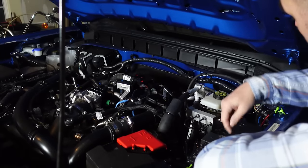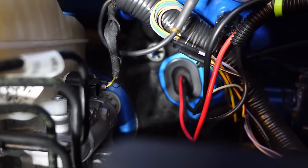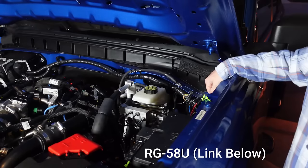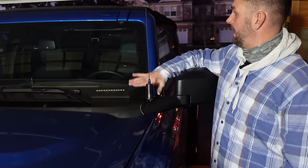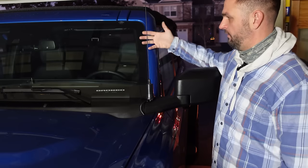From the 12 gauge wire, I went through the firewall. There's a little plug and all I had to do was drill a small hole in it to put the two wires through. Over where the tubing ends and the wires go into the passenger compartment, I have another zip tie — and this zip tie also goes to where my antenna cable runs. So here I have RG58A running to my Larson 2-meter 70-centimeter half-wave antenna, and I have not had any negative interaction with the vehicle. I think it's far enough apart, somewhere around a foot or a little bit longer.